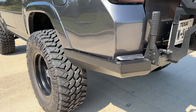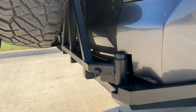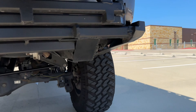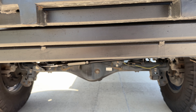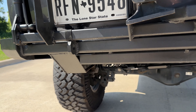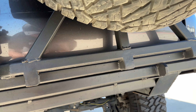We were inspired by the minimalistic designs they've implemented into the off-road game. Mind you, this is not a perfect bumper — not something you'd put on the market for customer satisfaction. I'm a simple dude, so with all the imperfections, overspray, and rough cuts, to me this thing is perfect. It does exactly what I need it to. Extremely minimal cost — we're talking less than $300 in materials. Some booger welds and flaws, but this thing is bulletproof. The bottom crossbar is two-by-three, 3/16-inch thick steel that replaced the factory crossbar. All the steel bar material on this build is two-by-three or one-by-one, all 3/16-inch thick steel tubing.